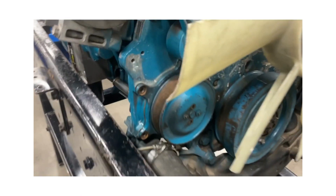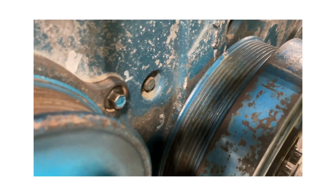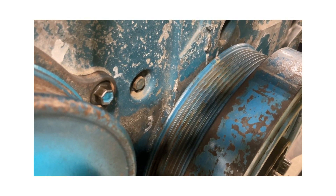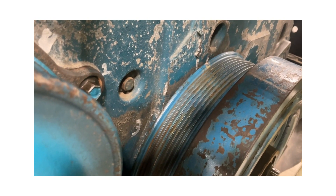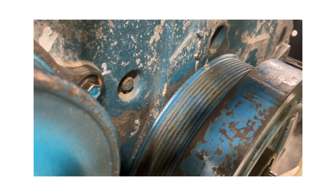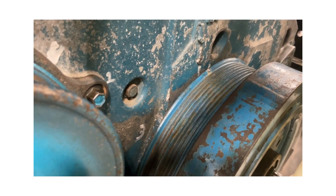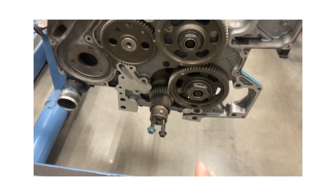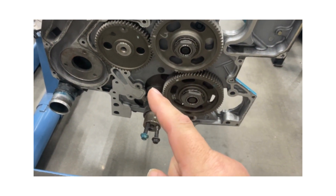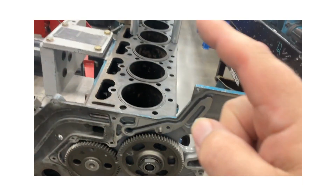The reason why that is important is if we look over here, you can see right inside here that there is a little notch on the back of the pulley and a little arrow pointing down at it. What it says right above it — and I know you can't see it in the video — it says TDC, top dead center. So when that little notch is lined up with that arrow, that could be all the way down there at the end.